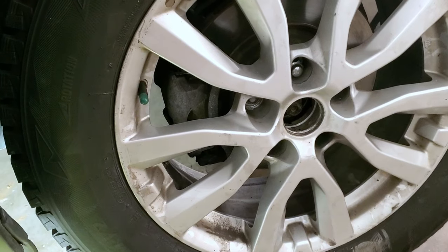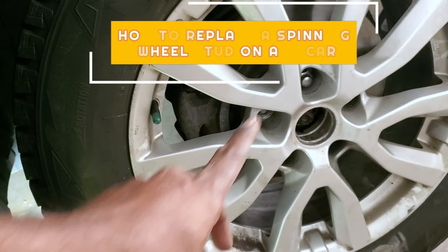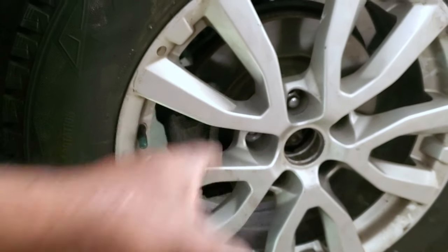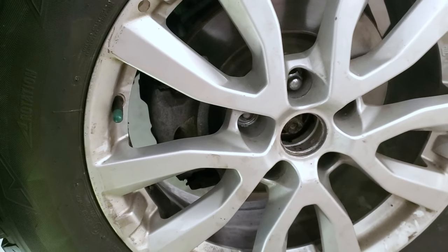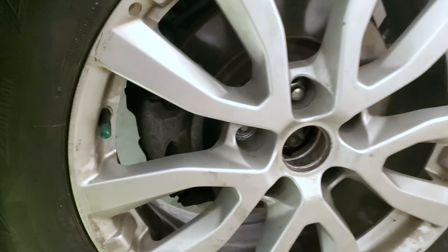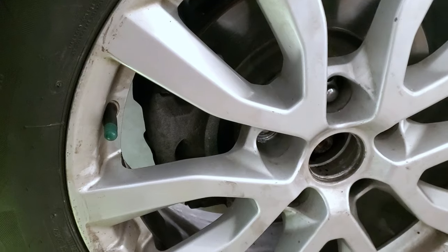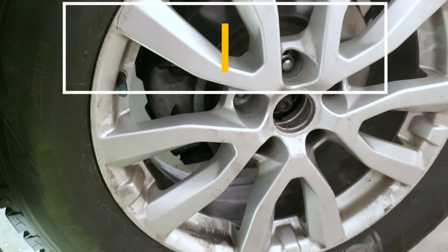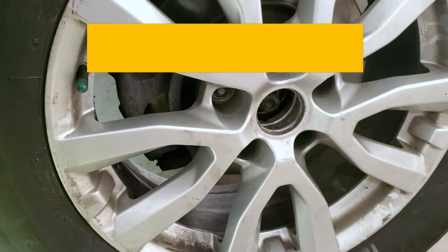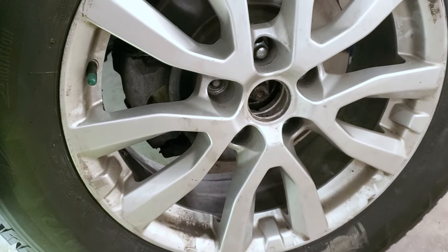While changing brakes, first step was taking off the lugs and we realized the lug nuts were spinning — and not just the lug nuts, the studs were spinning as well. The studs are loose from the hub. How do you take it off in this scenario? Usually you can break it off if the wheels are flush, but these wheels are not flush, so we need to do something. We're going to attempt taking the axle nut off and see if we can do it from there.